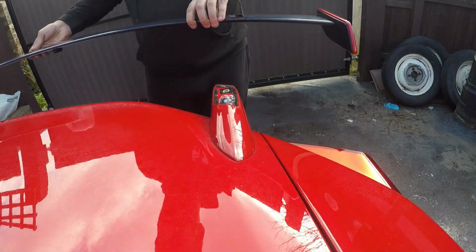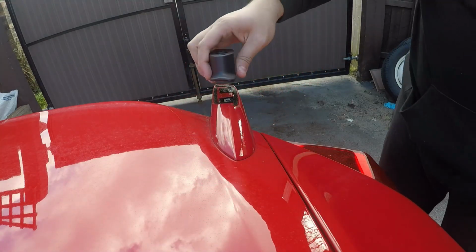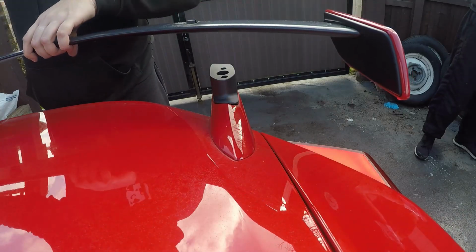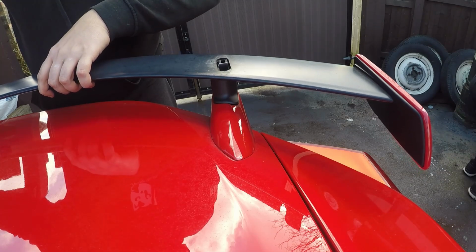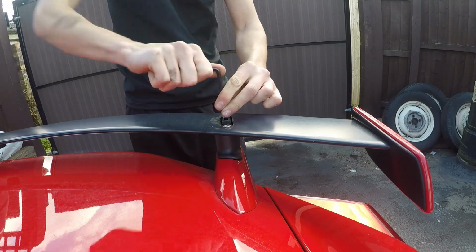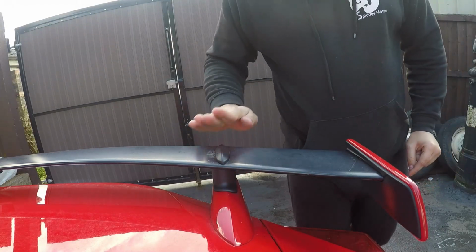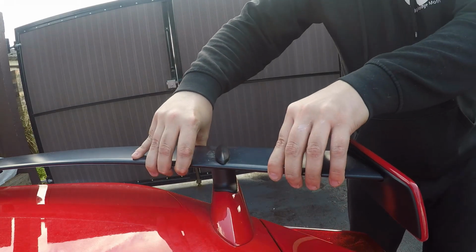After that, all you're really doing is adding your little 10mm rise pieces, little spacers, and then you're basically doing the same few steps in reverse. You've got a few longer bolts to fit in. The kit actually comes with some thread lock and everything else, so I believe all you're really going to need is a wrench to undo the original bolts and the pry tools to get the little caps off. But once you've got those back on, it's all done, all secure, and nothing really to worry about. So very simple, easy little mod.